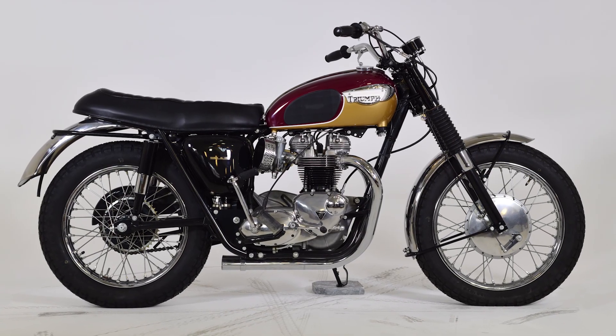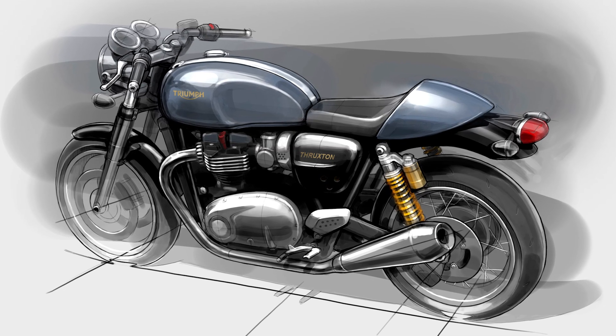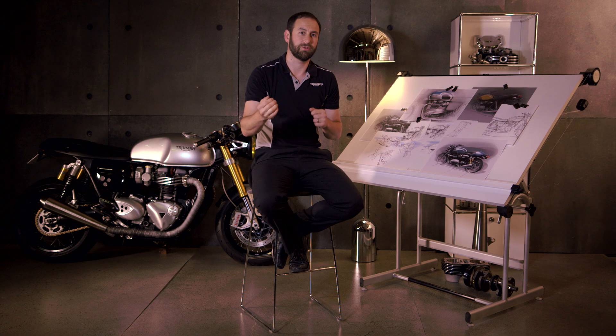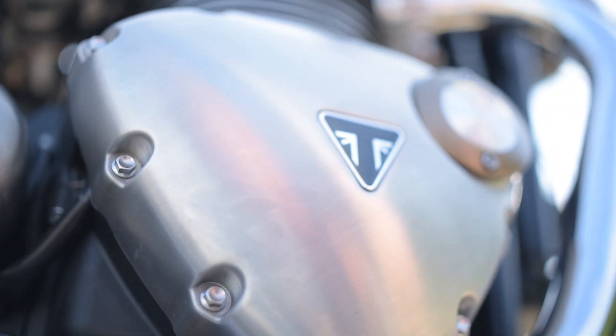To get the DNA of the Bonneville coming through on the engine, we had to start with design cues right at the start of the project. It was really important to get the overall engine proportions fundamentally right — this meant going through loops of redesigning cranks and pistons on some models. We looked at things like tooling splits, and rather than trying to hide them as on some modern engines, we made them more genuine and authentic. With the Bonneville, it was important that we didn't just engineer a powertrain and then apply styling afterwards — that wouldn't have worked.